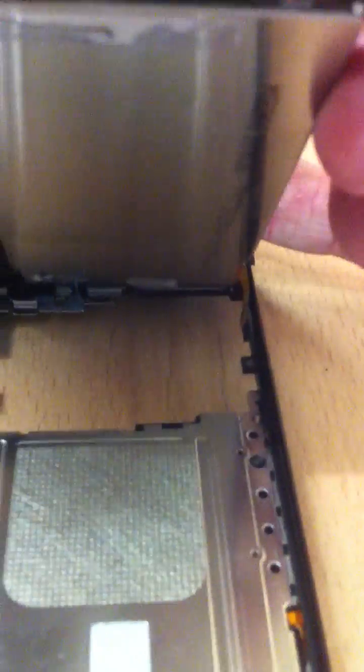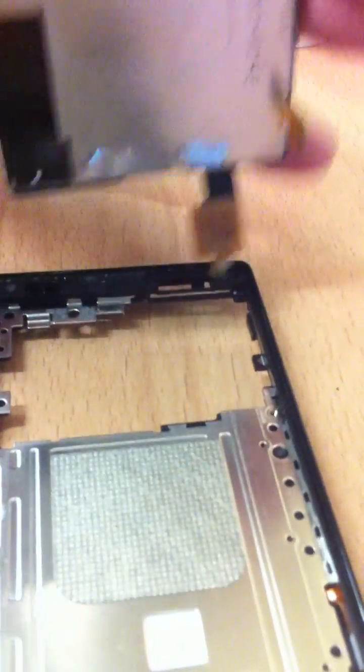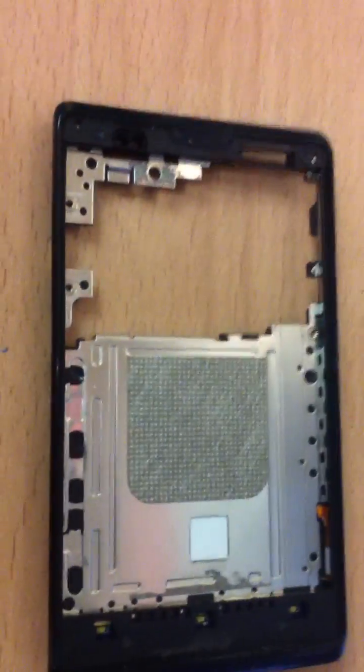All I've done is run a heat gun over the front of the digitiser, moved it up to about 90 degrees. This is where the connector is, so just be a little bit careful. Use the case opening tool, start it off where the little gap is and run the tool around. When you lift it up — difficult to do this with one hand — the LCD sometimes will stick to the digitiser. So you've lifted the LCD and the digitiser out of the frame, but they're not really bonded together so you can separate those. Keep the good screen — the digitiser is still working.